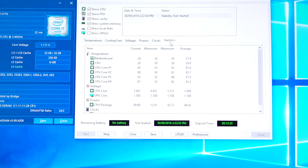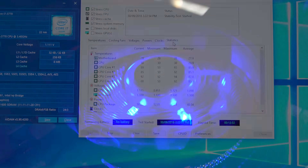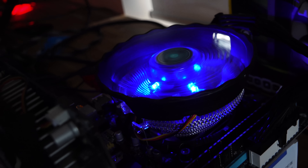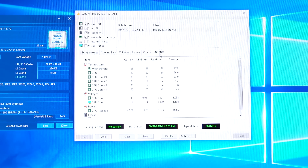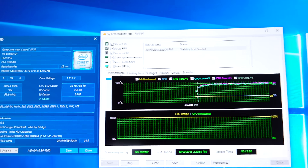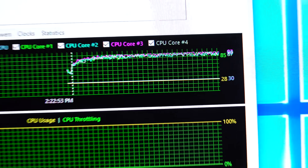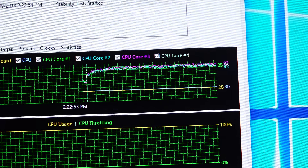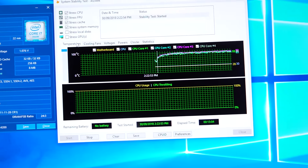Now it is not optimal to keep your CPU at around these temperatures especially 24/7, but it's not going to be too bad. If you guys are experienced with laptop CPUs, they actually do run a lot of the time constantly at 90 to 95 degrees. So you're getting laptop-style performance on your desktop PC. Also remember, this is a stress test loading the CPU at 100%. Usually games won't stress CPUs nearly as much, so you could see maybe around 80 degrees in games. I'm going to let it run until about 30 minutes just to see if it does throttle.